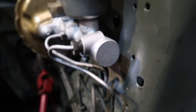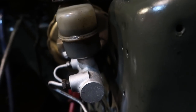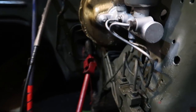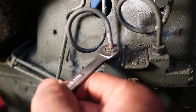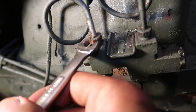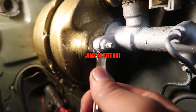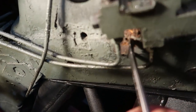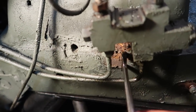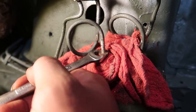There's one bolt on each side, so we'll undo all those bolts and hopefully all the lines come off easily. It took a little elbow grease but I was lucky enough to get things moving. The bolts look large enough and not too corroded, so they should pop out. I grabbed a shop towel to cut down on brake fluid running everywhere — brake fluid is nasty stuff and you don't want it dripping on your paint or on your brand new Maximum Motorsports K-member.